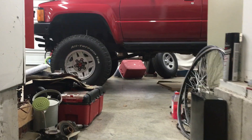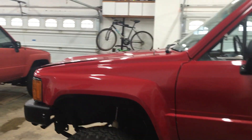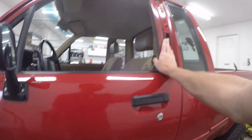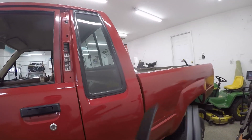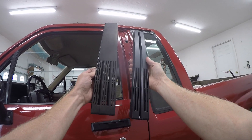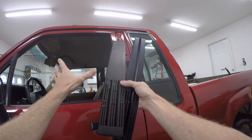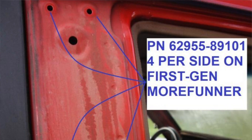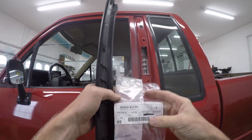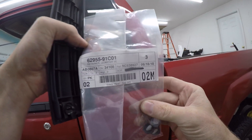Let's go back to the garage and I'll show you how to install B-pillar trim with new clips on my 1985 Extra Cab. This has been an eyesore for a while and I finally bought a trim cover on eBay. Notice the Extra Cab uses a thinner trim cover than the standard cab. I don't have a 4Runner here to compare, but it's really thick and uses 4 of the top and middle clips and just one on the bottom. So this is the bottom clip — it's different from the middle and top. I'll put the part numbers in the description.